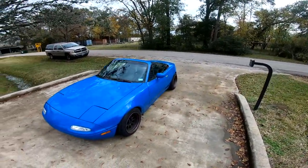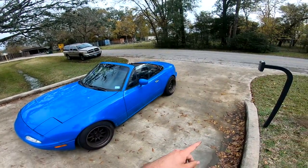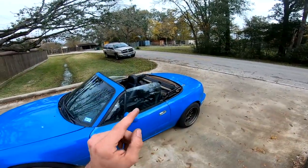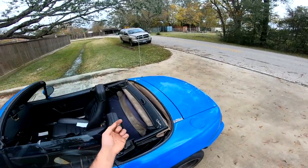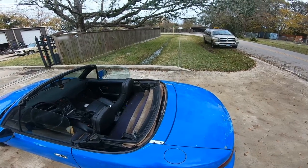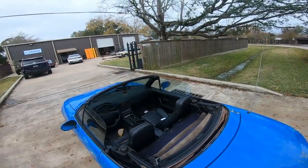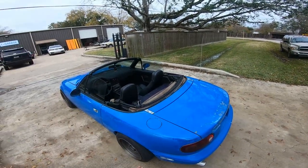And I haven't even washed it, honestly. So, I mean, that's all mechanically I've done to it. Oh, also fixed the rear line. There's a distribution block goes on that side, and the line that went up and over to this wheel, for whatever reason, the line was not flared correctly. So I had to take out the line and reflare it.